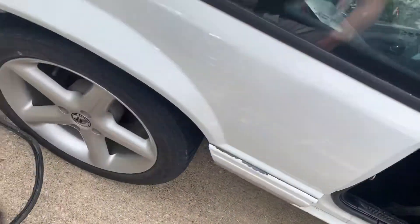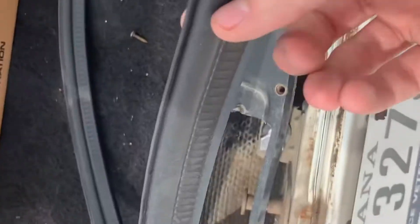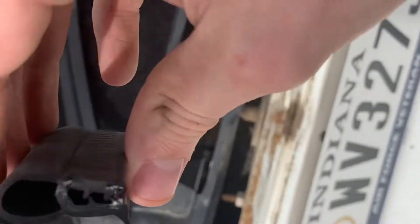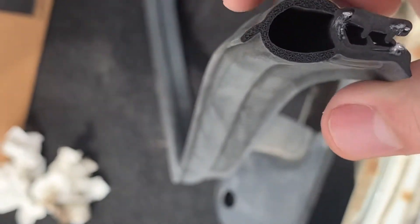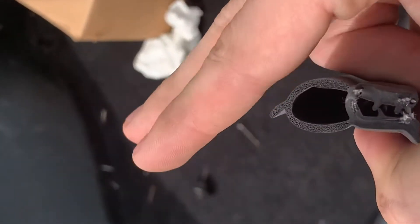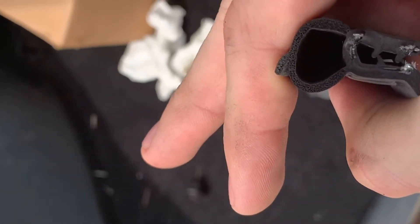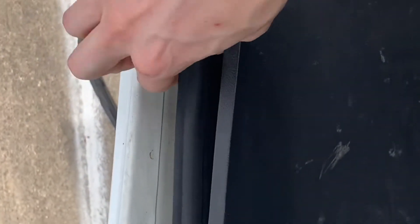I noticed in my videos I need to stand further back because I'm getting too close to things. With the weather strip, there's one thing you need to know: this piece here — see how it's bent this way — this needs to be pointing towards the outside of the car, like this. So when it shuts, it keeps everything out, not the other way around. The reason you get all the screws out is just so you can have access behind to grab it and push it down.